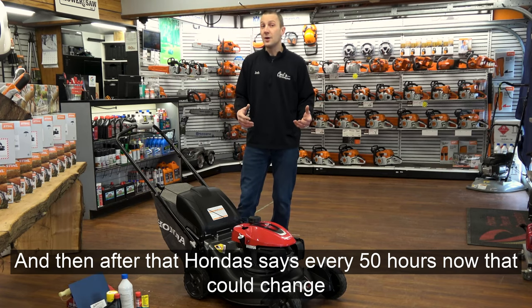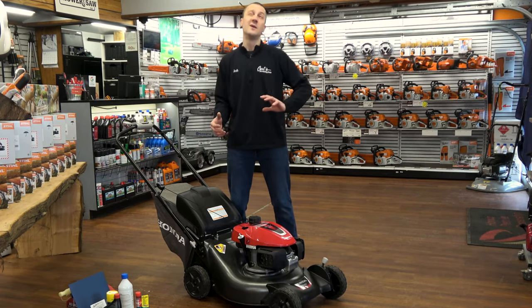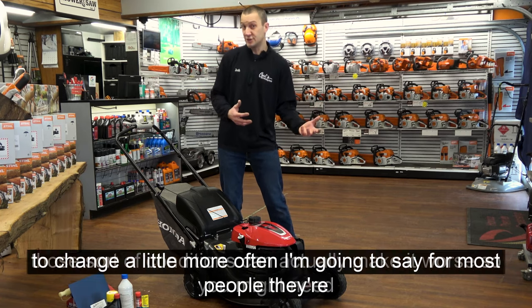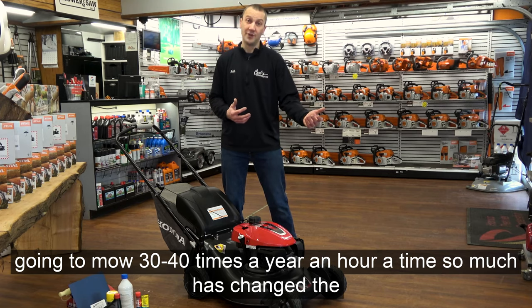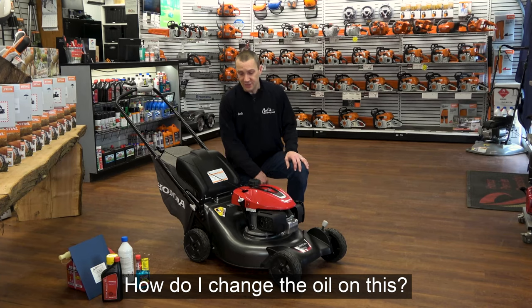And then after that, Honda says every 50 hours. Now that could change depending on conditions. Dusty, hot, those sort of conditions can actually make it worse, so you might need to change a little more often. I'm going to say for most people, they're going to mow 30, 40 times a year, an hour at a time. So let's just change the oil every year. Okay, how do I change the oil on this?